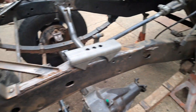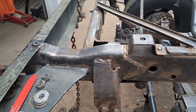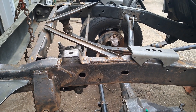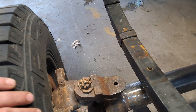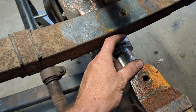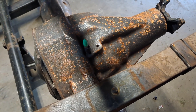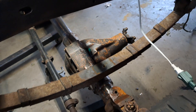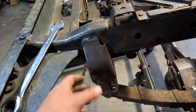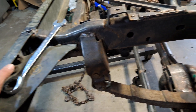We've got a piece of half-inch plate, and I'm going to clean it up and weld it up and bump this off by a half inch, because I don't see any other choice. Our general consensus is it's about two and five-eighths of an inch from there to there, and two and five-eighths from there to there is centered. But we can't get the perch to sit where it needs to sit without moving the springs out a half inch. So that's what we're going to start doing.